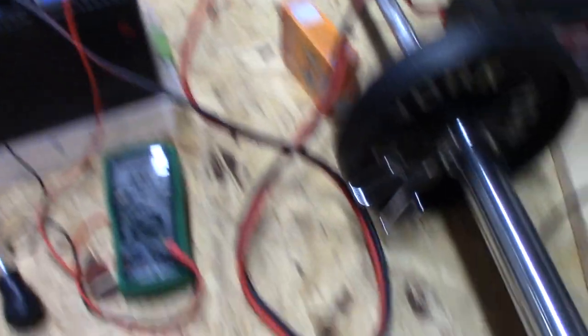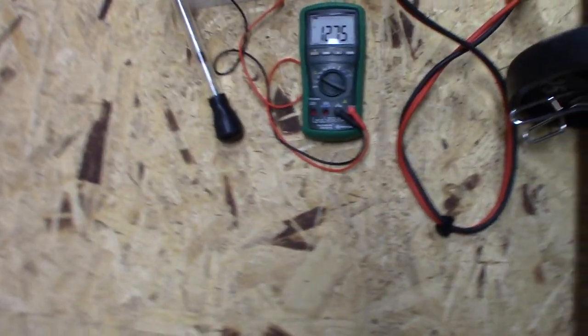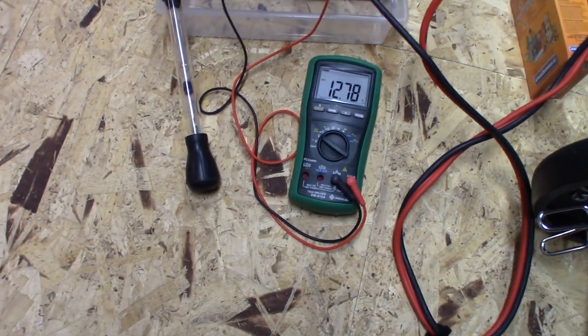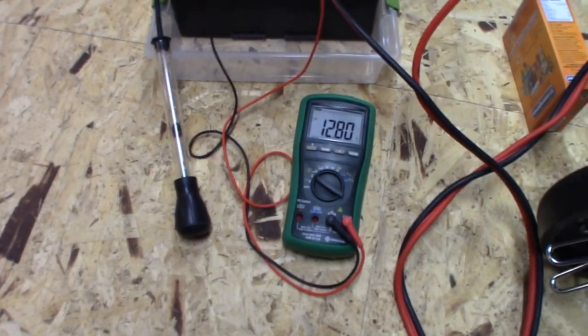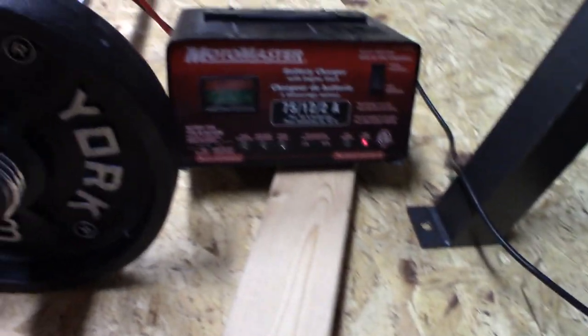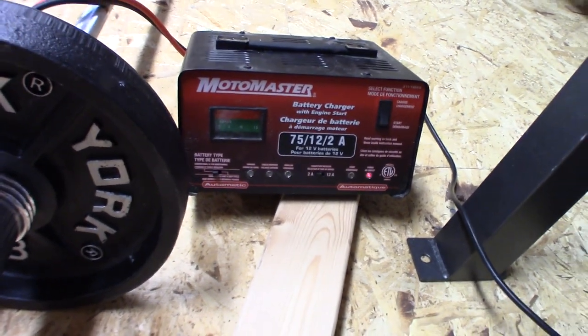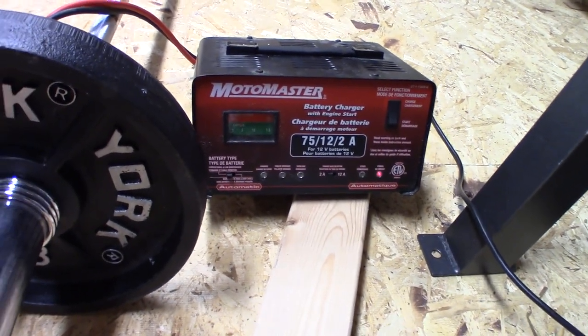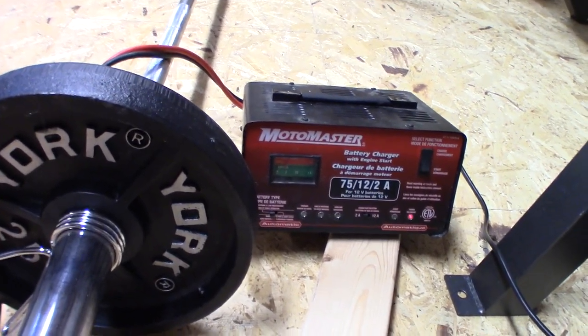I had this hooked up to a charger. Normally when charging the voltage would be more like 13-point-something, but I'm basically maxing out the amperage, which is set to two amps. The reason for that is because it's actually trying to charge a 10 volt battery with a 12 volt charger. So this is essentially overcharging the remaining five cells, and however long the battery was in there in that state, this is exactly what was going on.